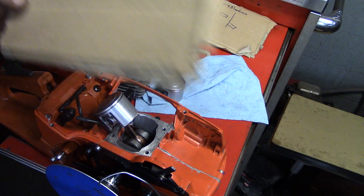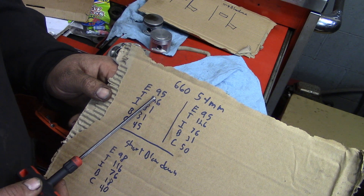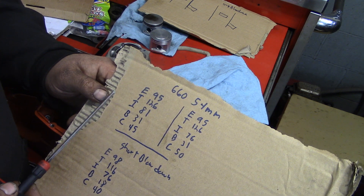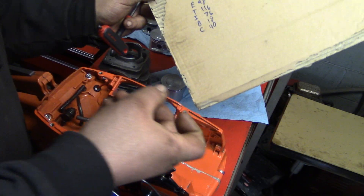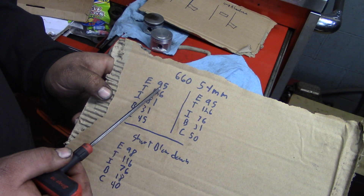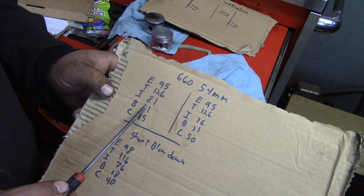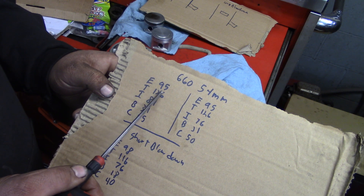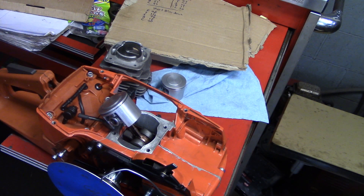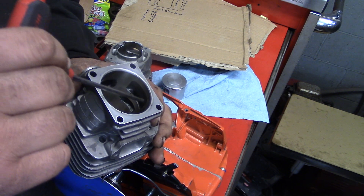The next cylinder I'm going to go over is my MS660 — this is when I started learning this stuff. That saw at first was weird; it didn't run right. On top end it would run out of fuel, and in a cut it would go lean and burn. You'd hit the throttle in a big cut and there was no power. Now, 95 on my exhaust, 126 on the transfers, 81 on intake, blowdown was 31, case compression was 45 degrees. I made a big no-no: I ground the transfers so they were dragged onto the case as well. That gains case volume, but you're losing crankcase compression.